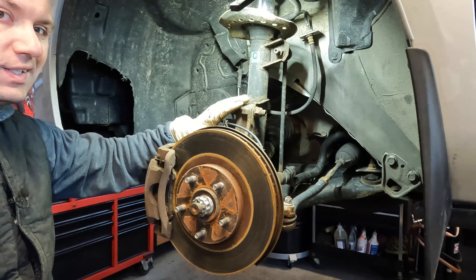Sometimes they can be rather difficult and this is the part that is the scariest. I'm going to get an adapter to put the gun a little bit closer so we can transmit more torque on here. The main reason I'm continuing to spin it is to break all the rust free that's holding that bolt on. Then I'm going to come from the back side and use a hammer to pull it off. See all that rust? That yellowing or oranging — that's what will hold it in place.